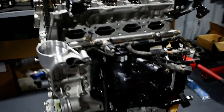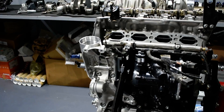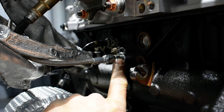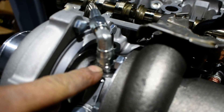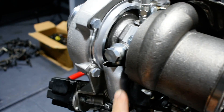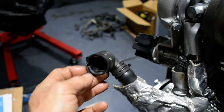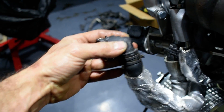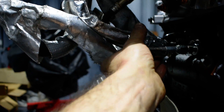On the engine: water pump mounted, the plate, the pipes — two pipes for the engine oil. Here the turbo is done. This is the oil feed — it goes like that, passing from this side and coming up here. This is the coolant line, which is aftermarket and has a Y-fitting. It comes here and here — this connection is for the heater core inside the cabin, connected on the body.